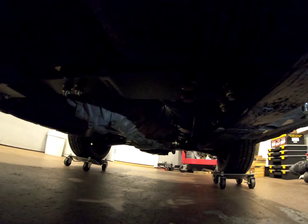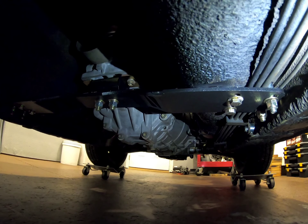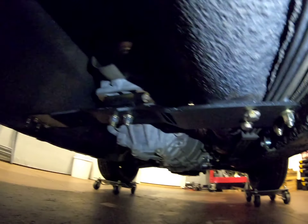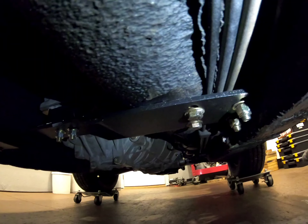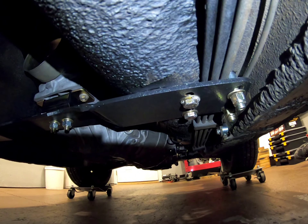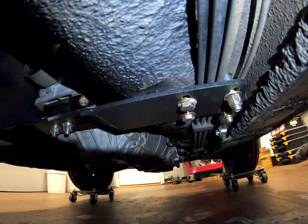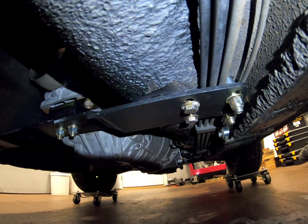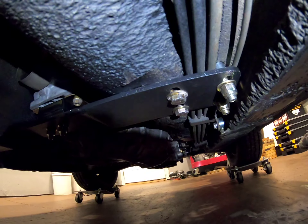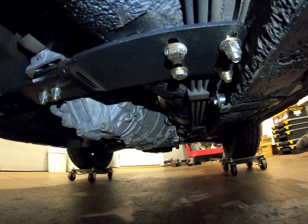The Apex mount spans the full width — I should explain this: the 240Z has the fuel lines and brake lines running through the transmission tunnel, but on the 280Z when you use the Apex mount it requires a spacer to shove it in between the brake line and the fuel lines. That way you can account for the uneven floor pan and get it to bolt down evenly without crushing the fuel lines or the brake lines.